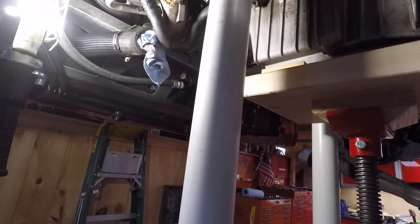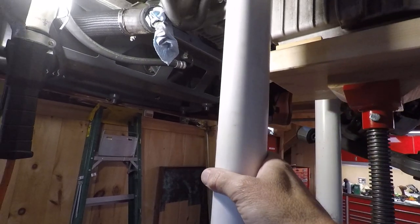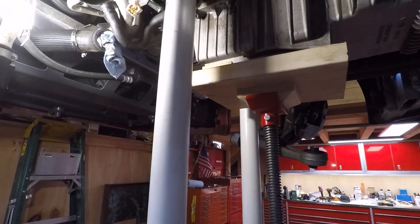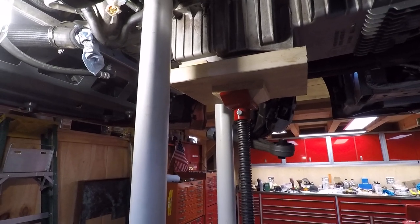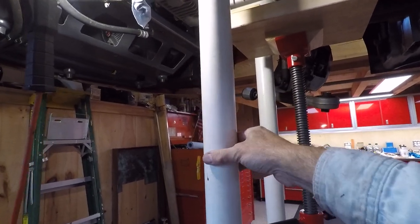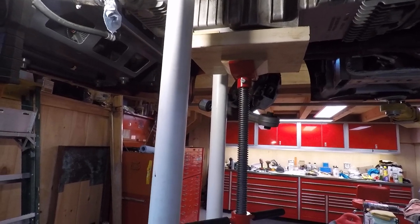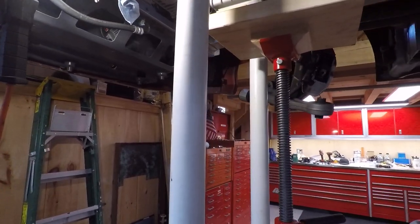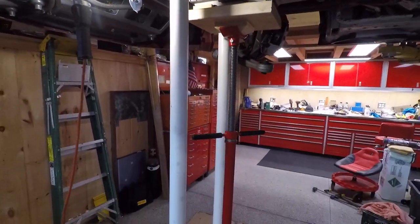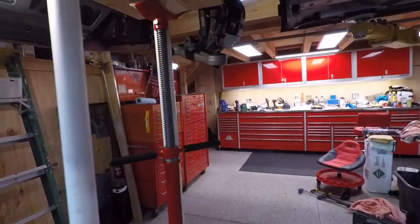I could support the engine with this and then put these exactly under place. This is being filmed in April — this job I'm doing in March and April 2020, which means it's during the coronavirus lockdown. This is all I had at home. I thought I had some six-foot black iron pipe I would have preferred to use, but I couldn't find it in my barn. So I do have some of this two-inch PVC, which is more than strong enough under compression like this to hold up the weight of the engine.